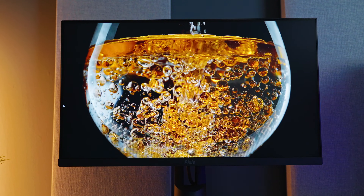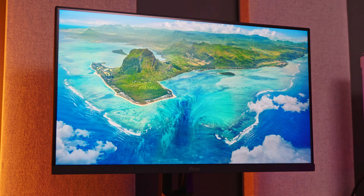Focusing more on the display itself, it's pretty impressive — really color accurate, which is not something you expect from a gaming monitor. The PX248 Pro covers 134% of the sRGB color space as well as just under 90% of the DCI-P3 color space, and whilst gaming the colors look fantastic. Personally, I do find 1080p at this screen size a little soft or fuzzy for day-to-day use, as I'm just used to 1440p or 4K displays. With a PPI of 91.79, it's about as sharp as a 2560x1440p display at 32 inches.